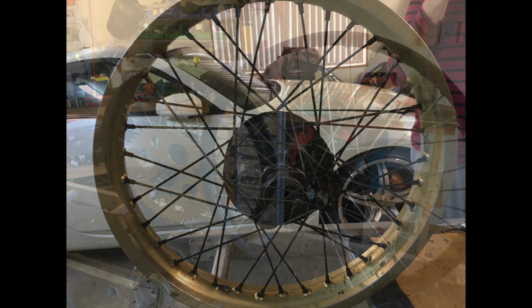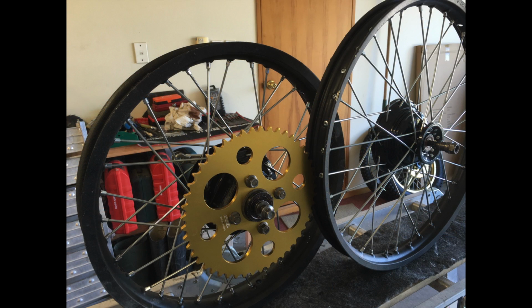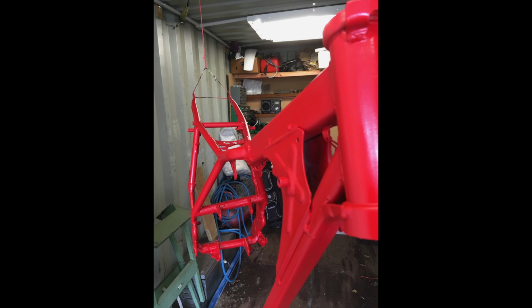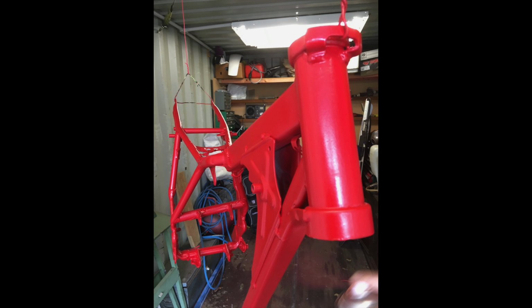to help things along, those ball bearings and the bearing races and the steering races needed to be thrown out, and we put new roller taper bearings in there. That was really good. Front suspension is another area that needed to be looked at. Obviously, this bike had been abused a little bit where we got it from, so we tipped the oil out of the front forks, replaced the seals and the dust covers, and put it all together again.